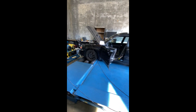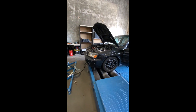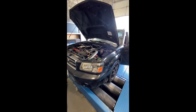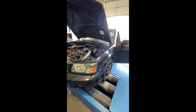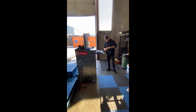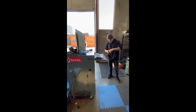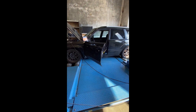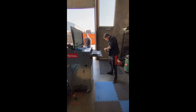She made really good power. For this setup on pump gas, it's definitely making a little more than typical. Usually we see like 350 on this setup on pump. He's doing 368 — that was the high pull. So she's ripping and doing good — should be fun at the track. Yeah, breaking another axle at the track! Well, the clutch in this thing is so aggressive, I'm not surprised he's breaking axles. It literally felt like a dump truck when I was pulling it on the dyno — it was that chattery. But I think the car's doing good, so he should be good. We'll have to bring the Honda up here and do some pulls and see what it makes.